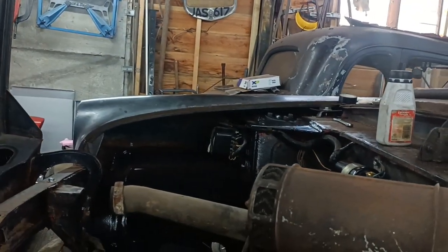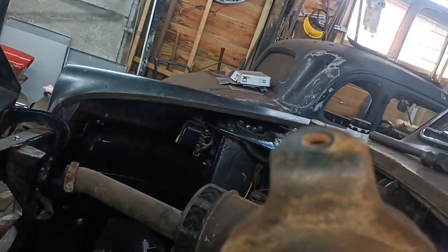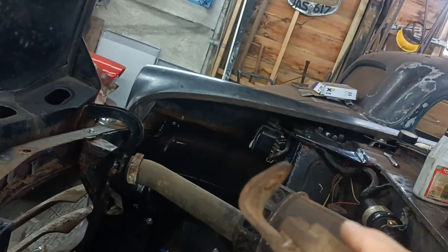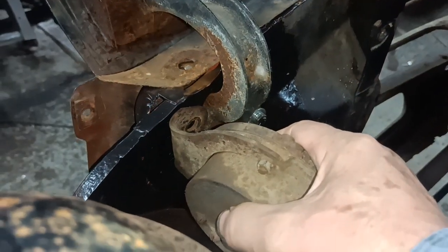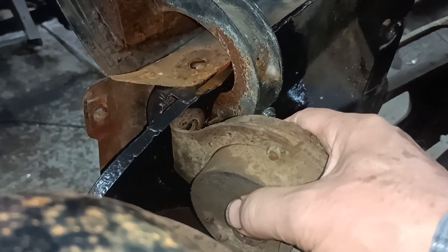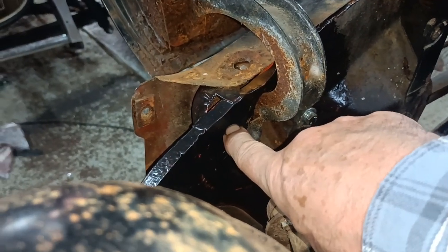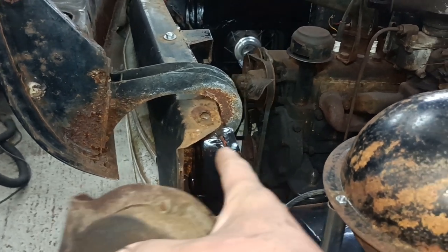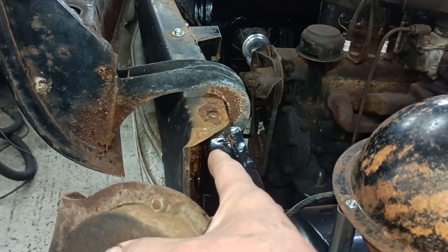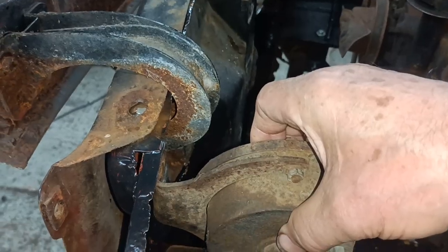The other job — since I don't have any welding gas — is the horn. I believe this is the correct horn for this job, though it doesn't look very factory the way that's bent. It does fit, but there should be a captive nut there and there isn't. So what I'm going to do is drill right through the front piece as well, drill one of the holes oversize, put in a spacer tube and bolt it all up tight.